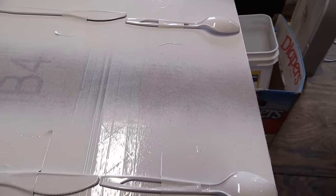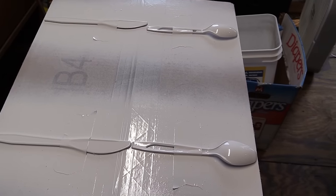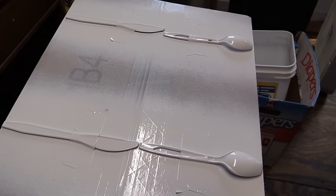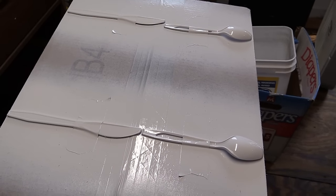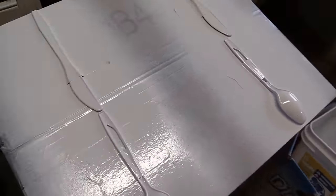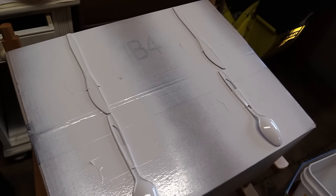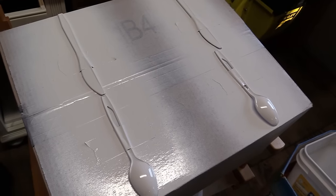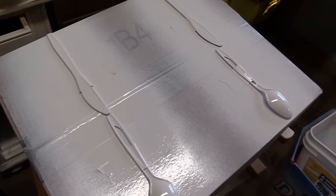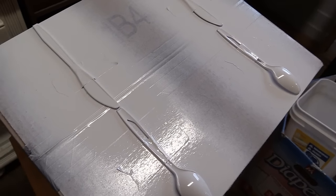Little known fact: you can put your clear coat on with your flash coats. Say this was three coats — a mist coat initially, then a little heavier coat, then a real coat — and those were all within about five minutes of each other, which is something you can do outside because the sun dries it super fast. But inside, if you were painting in your garage, you would want to wait about twenty minutes between flash coats to get them to lay down properly. Your final flash coats can be clear coats, right on the enamel — the clear lacquer.